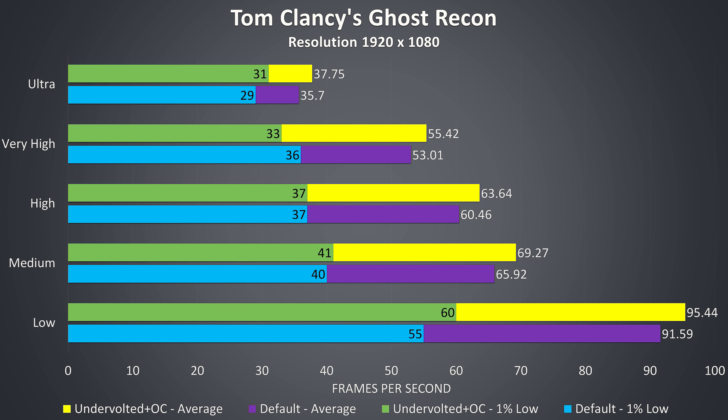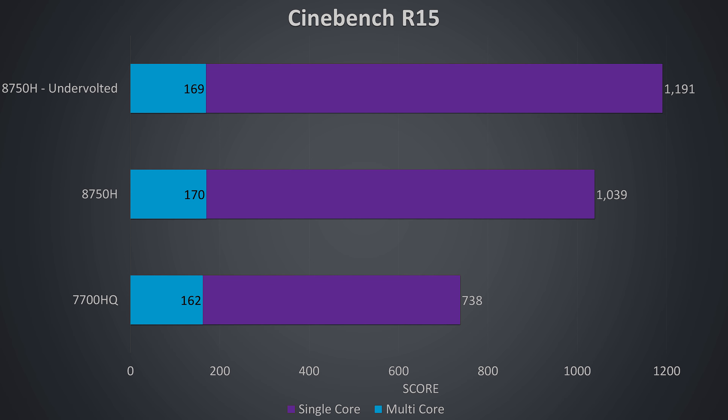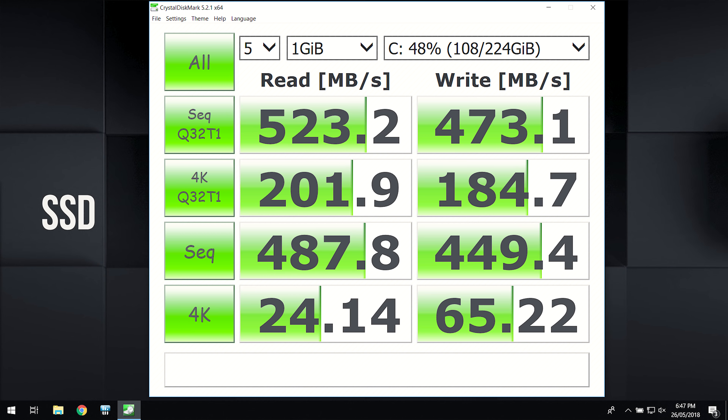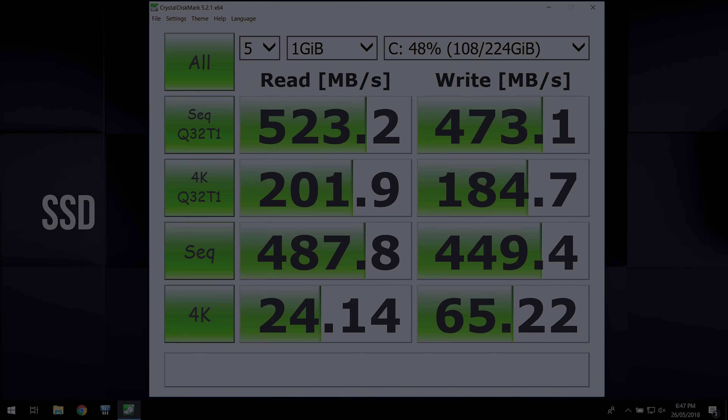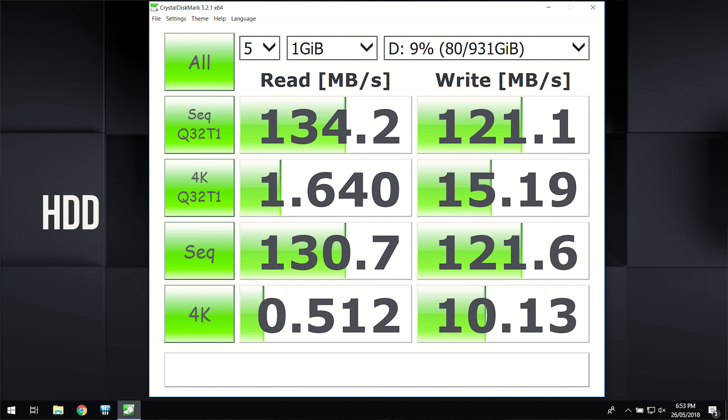It's important to keep in mind that these results are with the top end G5 — it's also available with 1050 or 1050 Ti graphics, with single channel memory, and with the 4 core i5-8300H CPU, so expect lower results with a lower specced model. The 8750H CPU can't be overclocked, but I was able to increase the GPU core clock of the 1060 — although I tried applying a 200MHz increase it only rose about 136MHz on average due to the power limit being reached. With both CPU undervolting and GPU overclocking applied we get a little boost in games, but not really enough of a difference to justify retesting all the games.